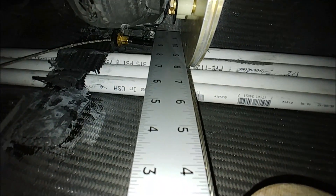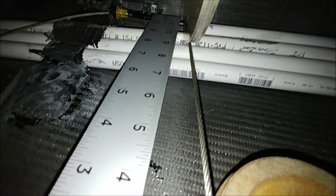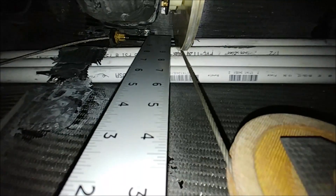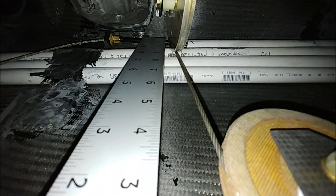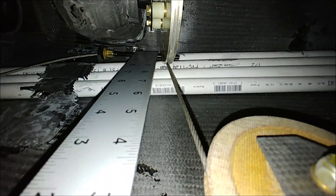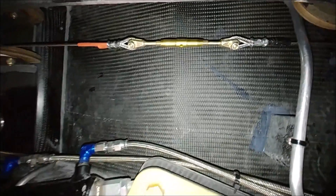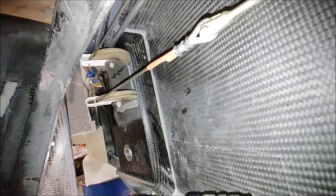That fixed the problem — it's now aligned perfectly. The cables have been tensioned and everything is set up and working nicely. We marked and measured where we were bonding those pulleys on the floor into place, and they were out by half an inch. Looking behind the pressure bulkhead you can see the turnbuckles — left and right — and all the pulleys. The cables go up and out to the outboard edges of the spar and then back across the middle in a continuous loop. That's all sorted out now.